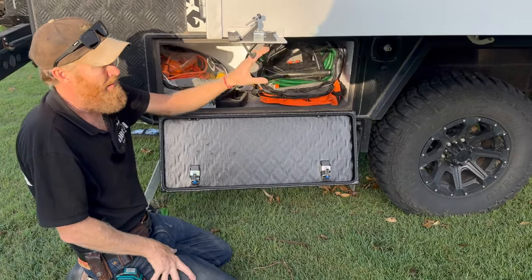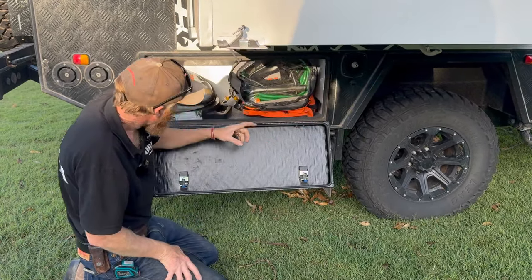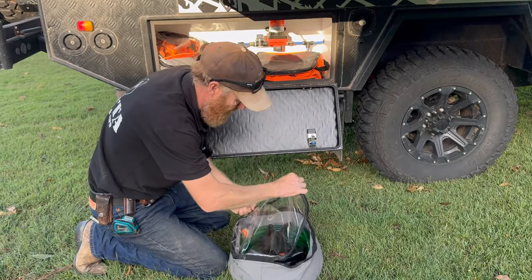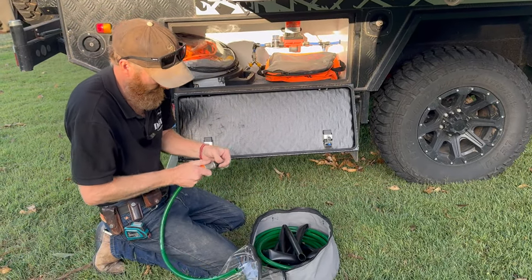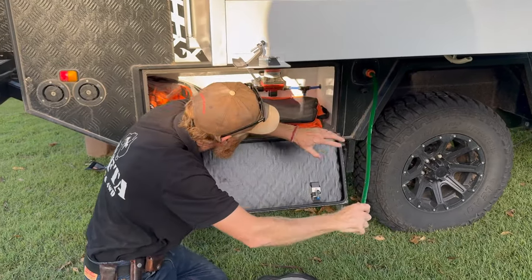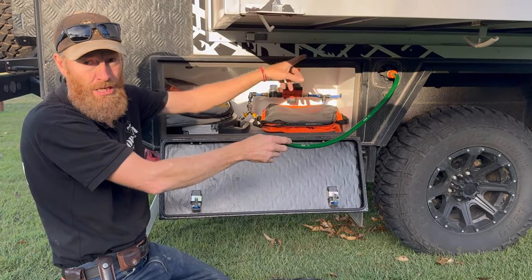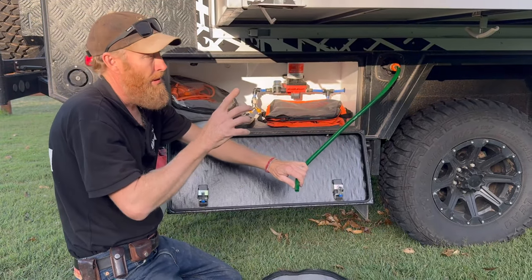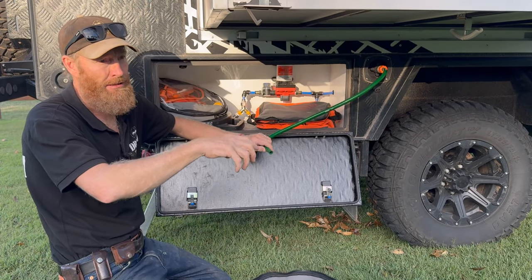Okay, but I'd suggest with that, if you hook up to there with a hose, that will bypass your water tanks, okay? Now I've got this small hose here, so let's just pretend that's mains pressure, click that on there. That's not going to fill your tanks, but that's going to operate your shower and your sinks, okay? But I'd suggest don't turn it on full power, okay? You only want sort of half a turn, so the water's coming out.